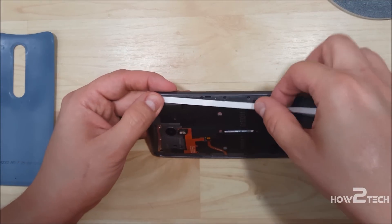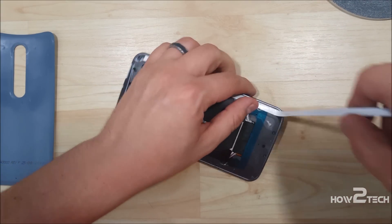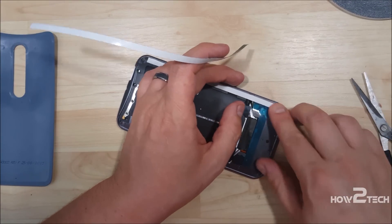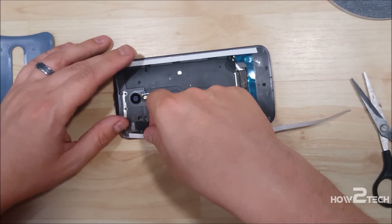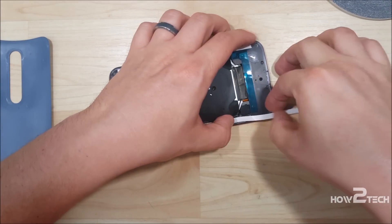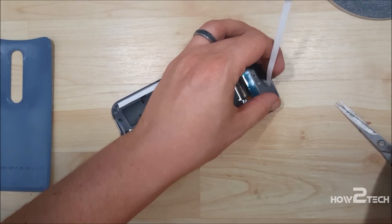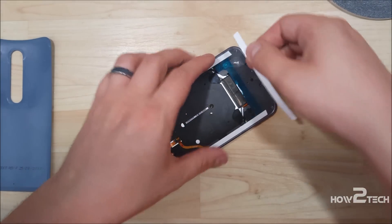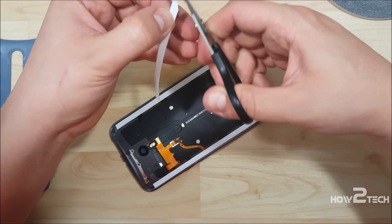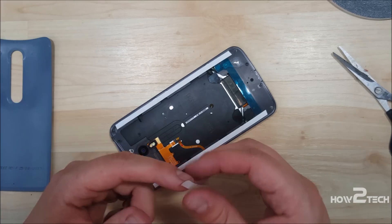What we're going to do is just take this tape and run it all the way around the back. This doesn't have to be the exact same pattern it had on the phone — the goal is that you get good adhesion of the back cover and you need a lot of tape to make sure it's not going to come back off. Run it down in strips, doing the perimeter edge first, just down each side of the phone in nice straight lines. It's okay to cover up a little bit of the ribbon cable. If you take the phone apart again, just be very careful when you remove it off that side. Contour the corners at the bottom and make sure the tape lines up correctly in the edge.